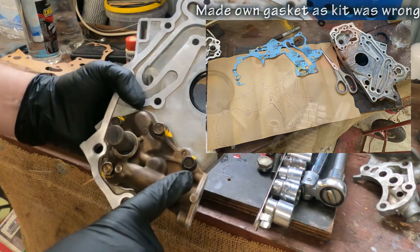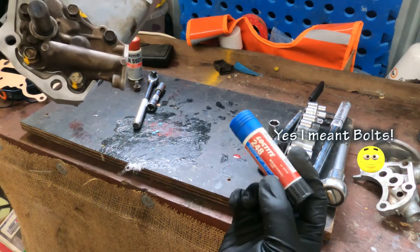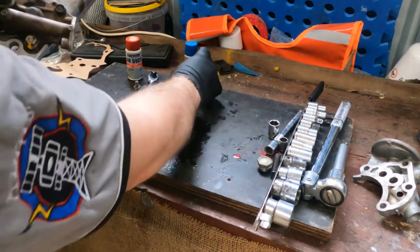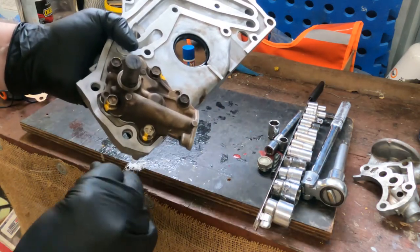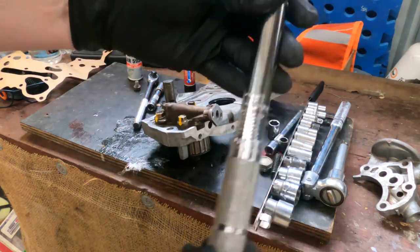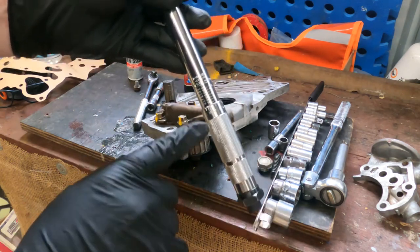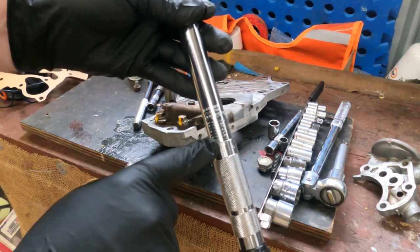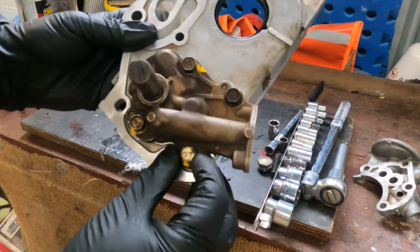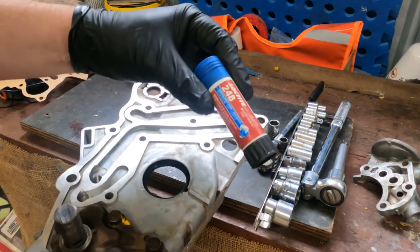With the oil pump retaining screws, I always put a bit of Loctite on the screws. This Loctite doesn't interfere with your torque strengths. The reason I do is because it's a highly critical part. I've only got one size torque wrench, which is a 3/8 torque wrench, and the 17 newton meters for these bolts is way down on the scale, which means it could be inaccurate. Because there's potential inaccuracies, it may only be plus or minus a couple of foot pounds, but just always be rest assured with a medium strength Loctite on there.